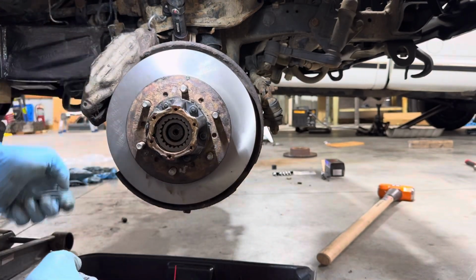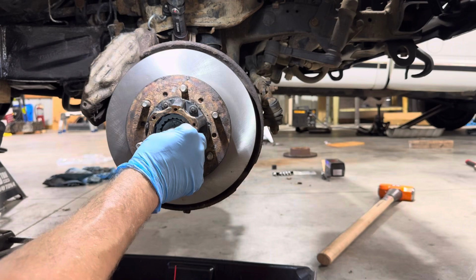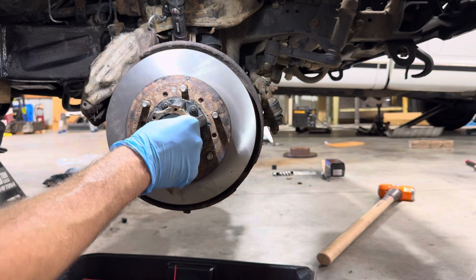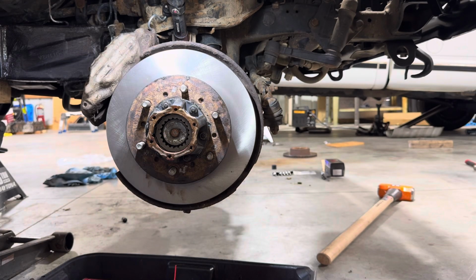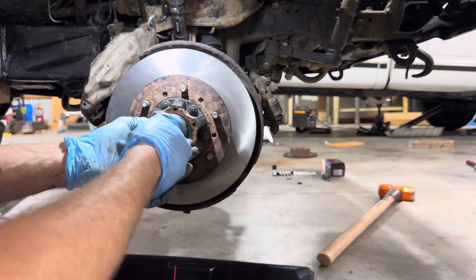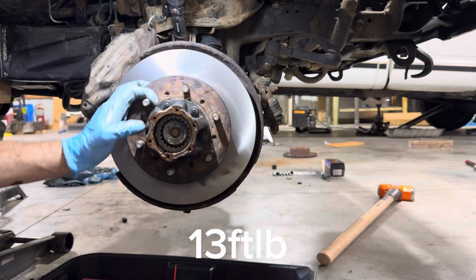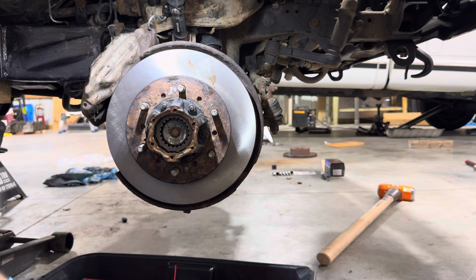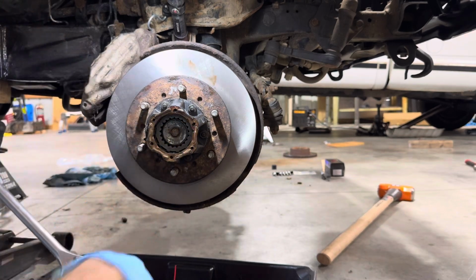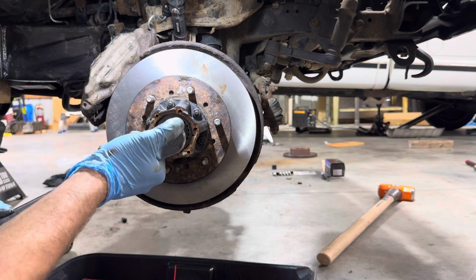See how this is spinning right now? Spinning good. Okay. We're gonna get these in here. Now this is just very gently tightened up in there, because if you tighten it too much, you'll notice the axle's not going to turn. So they're just running in there by hand. Okay, we got a little bit of resistance. Now, I'm just going to do the slightest amount of tightening it, and it's hard to turn now, so too stiff. Just doing that for the video purpose.